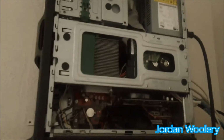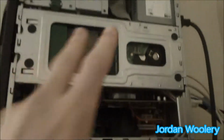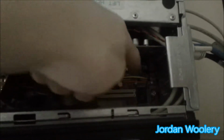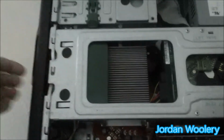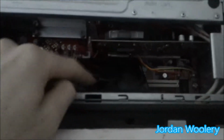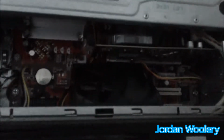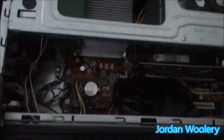And I guess while we're waiting, you can take a look on the inside of this redneck server, I should say. I have this 120mm fan aimed up against the video card to kind of lift some air around the case, plugged into a system fan header. The CPU fan in there is also 120mm, which sucks air through the front of the case and out the back, which is BTX style. It also plugs into a fan header on the motherboard, which I don't use the CPU header for because when I plug this fan into the CPU header, it goes absolutely crazy whenever you do anything on the system. So something's wrong with the thermal monitoring on that particular port, so I can't use it.